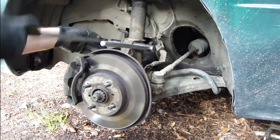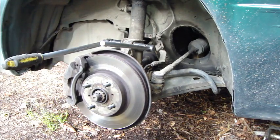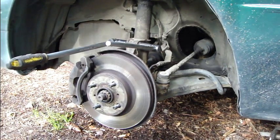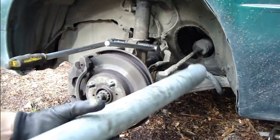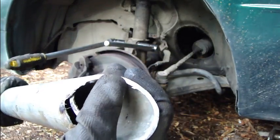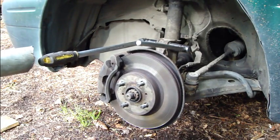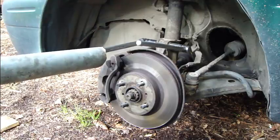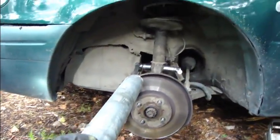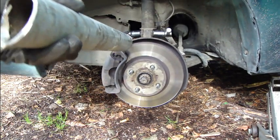And what you install in here, and of course both of these tools must be good quality tools, and then you need extra force and moment. I have that kind of metallic pipe, whose thickness is something like 5 mm, and then I install this pipe in here, and then I have a good moment when I start to open this bolt.